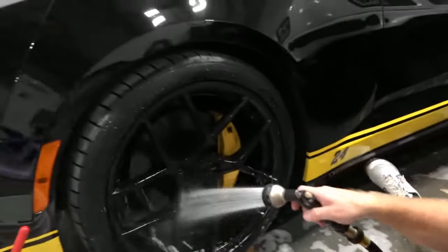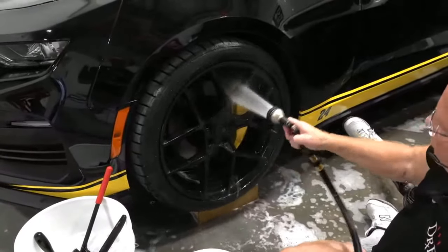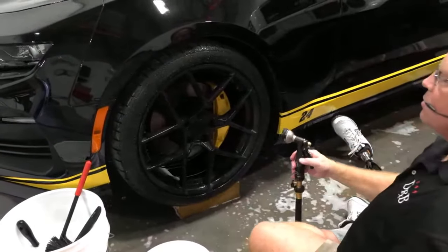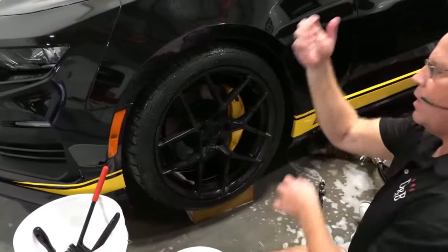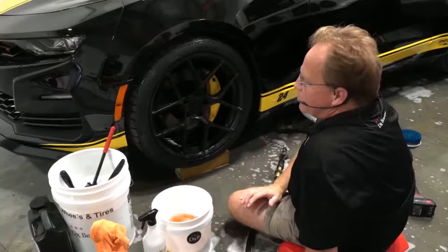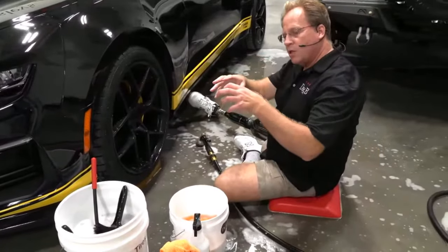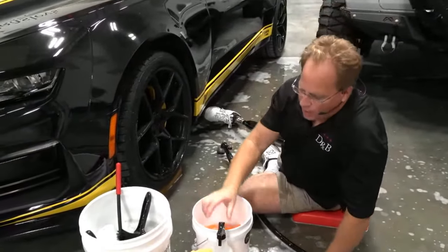And I use the shower setting for cleaning engine, for doing engine detailing. In our classes, I teach people the intelligent way to clean a motor, and that's not with high pressure, which pushes water into places it shouldn't get, but with just a gentle spray. You should clean it using brushes and a great degreaser, and use elbow grease to do the cleaning, not high pressure. And just to comment on that, a lot of times when you get done doing a wet wash engine detail, the engine will turn on and you won't see a check light. It's not till 2 years down the road where water got into electrical connections and caused corrosion, then you get the problem. So don't be that guy.